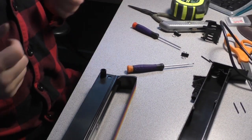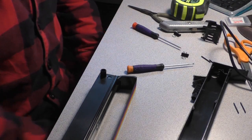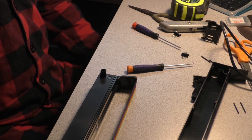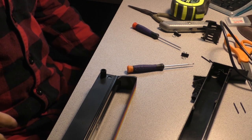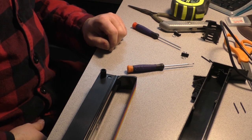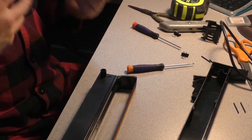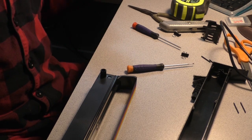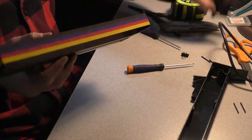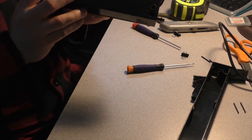So what I'm saying is, let's say, I'm going to make up a printer here. Let's say you've got a McDonald's 2000 printer, and it happens to use a one-off printer engine that was made by Hitachi Suzuki or something in May of 1987, and they only made them for a month, and it uses a weird ribbon. As long as it uses a standard fabric ribbon, you can find a printer that uses one, maybe pick up a couple of old cartridges and see which one has a ribbon that's the width you need or close to it, and you can make yourself your own ribbon by unpacking, basically doing what I just did. I made lemons out of apples.